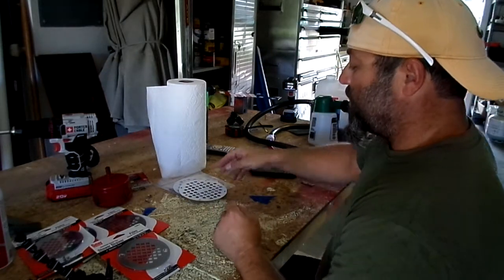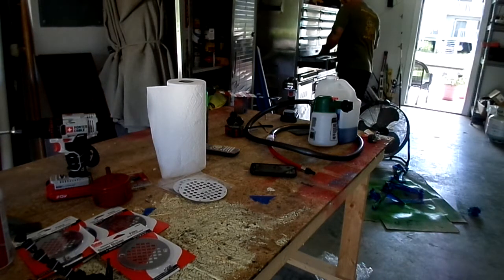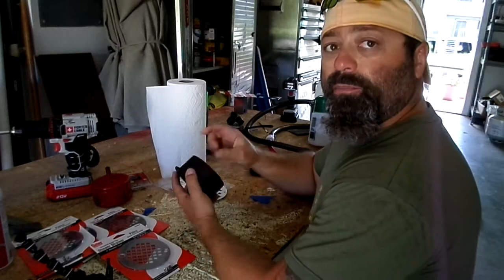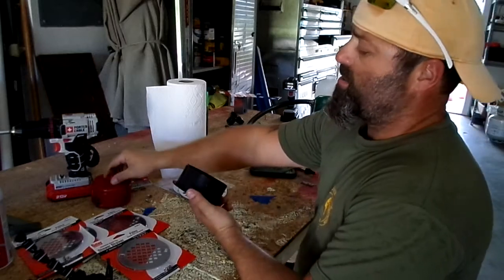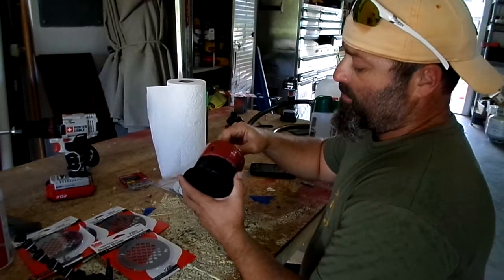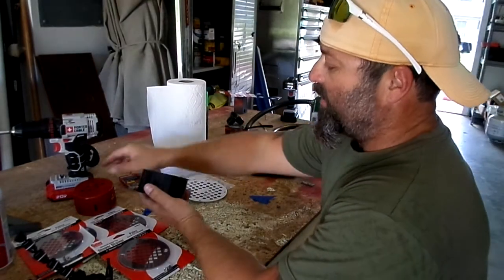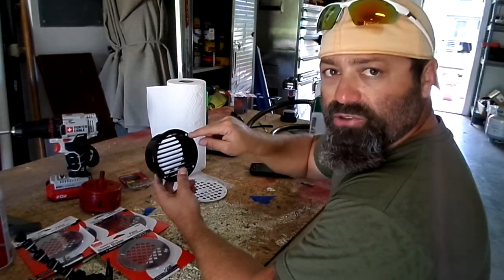And again, there are other products that you can use. These are the ones that I used on my old boat, for those of you that didn't see it. These are black plastic, and they're like $3-4, I think. I got them at Lowe's or Home Depot. This particular hole saw was a dead match. So I drilled the hole, and I had to get my Dremel tool with a grinder bit and open up that hole just a little bit more, because these are the exact same size. And they just fit right in there. A couple of pilot holes, stainless steel screws, bam.